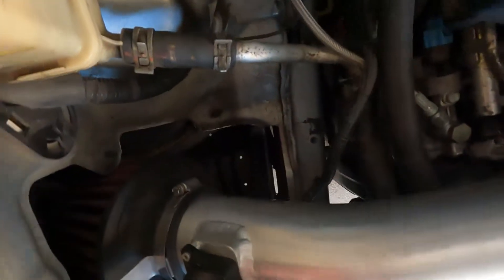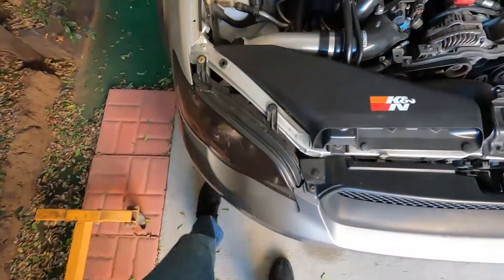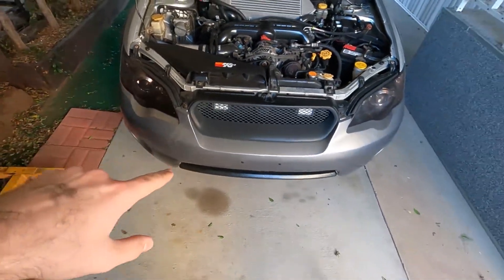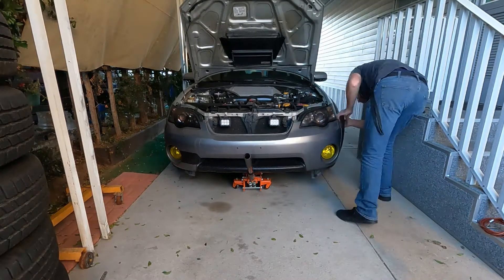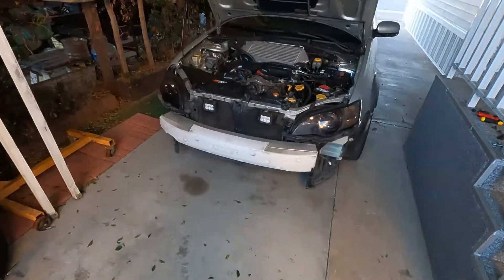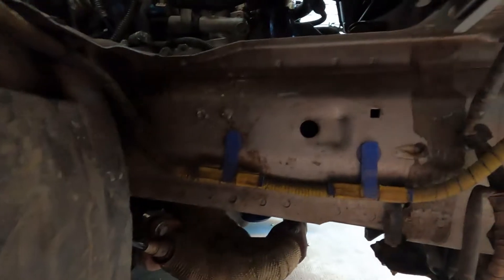As far as where I'm going to mount the relay box, it's going to go right down here on this frame rail on the outside, right below the intake. In order to get access to that spot, I've got to pull off the front bumper, so I'm going to do that real quick. All right, so now that the front bumper's off, you can see where I plan to mount it. This little square hole right here — I think I'll drill it out larger so I can put a riv nut in there, and then the other riv nut should go around here, and that should give it a good spot to mount to.